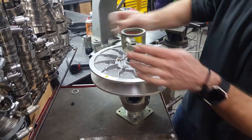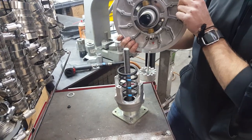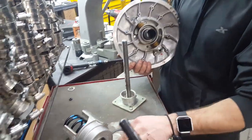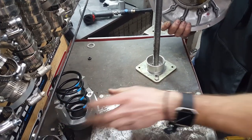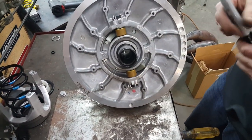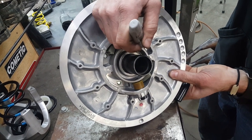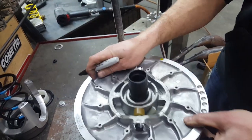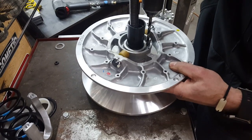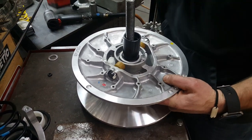There's very minimal pressure right now, so it shouldn't be tight. If it is, be careful. The clutch is now apart. See this piece right here — that gets thrown away. There's another plastic spacer; save it or toss it, you don't reuse it. Now this piece here — you're going to want to find where the roller is, go halfway between it, right in the channel, right beneath this mark.